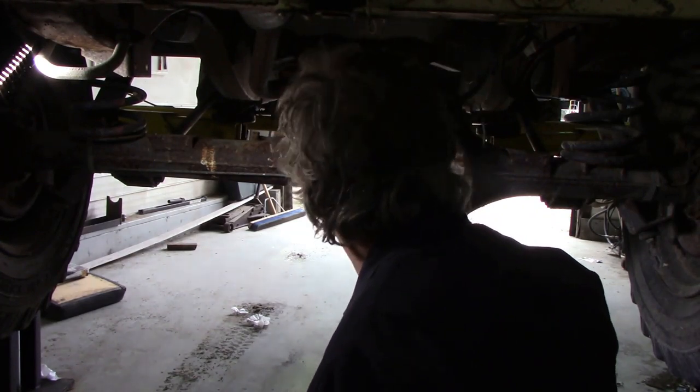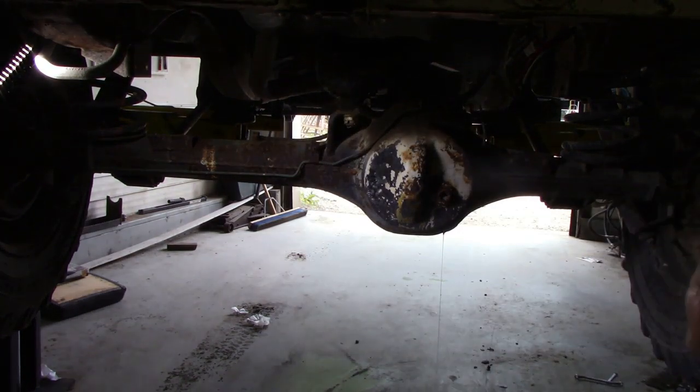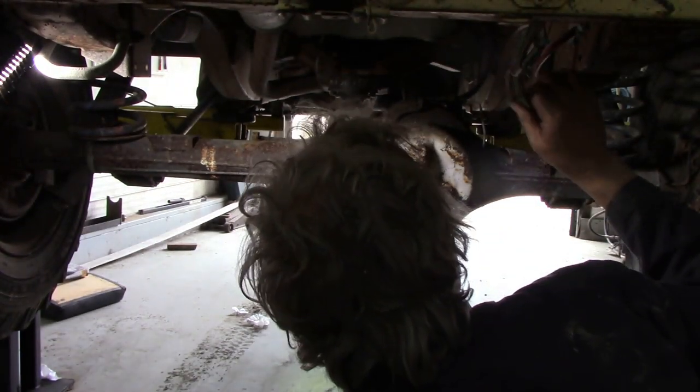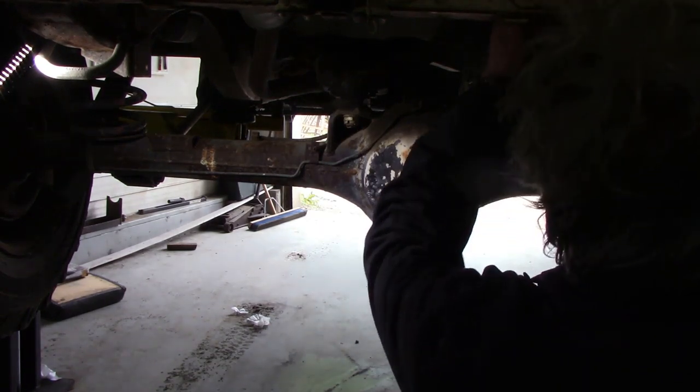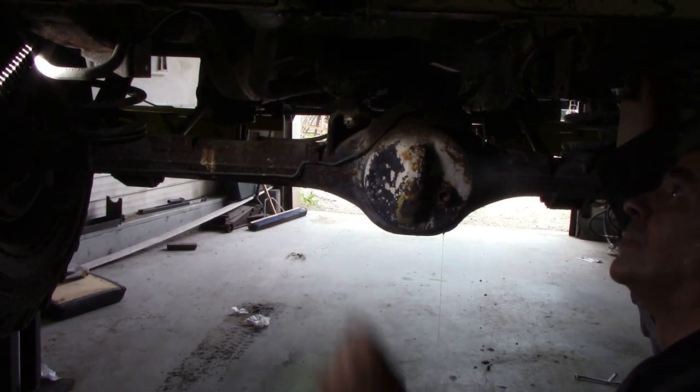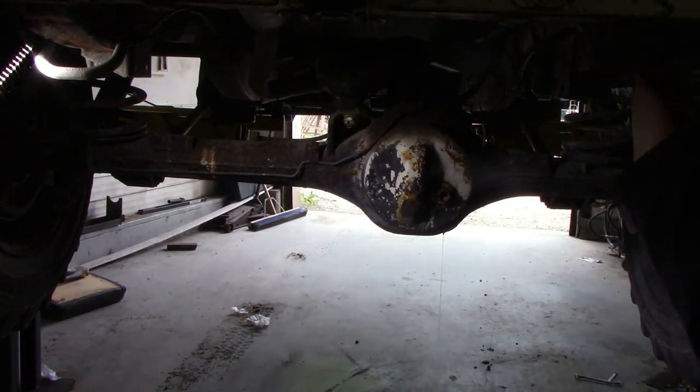Bump stops are on, which is rare. Looking around this back area, the wiring insulation has come off and it's come off its clip. What I'm going to do is tape all that back up before I clip it. I'll put some tape around it all at the top as well.